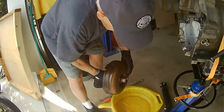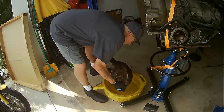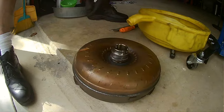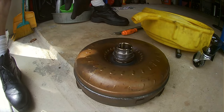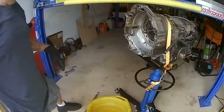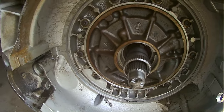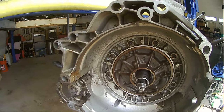So it's ruined the torque converter and the pump. Well, we know why it was making the noise. Let's take a quick look here — it's a shame. Look at that. That thing is seized on there, and there's the seal. Holy guacamole. I guess it's ruined the pump — unfortunate. Right in there is where the bearing should be, and it seized to the torque converter, and that was the end of that. Thanks for watching.